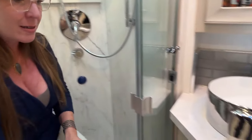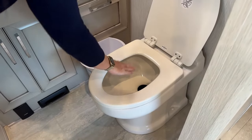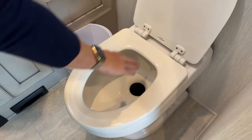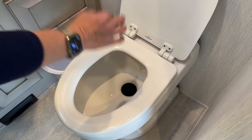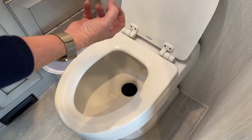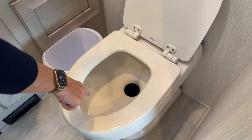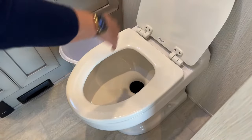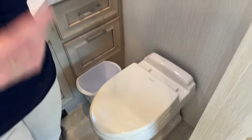Before you use your toilet, fill the water level up a bit first and flush it a few times, then put your treatment in there. If you're using a pod, you have to let it dissolve completely before you flush it — the plastic the pods come in will ruin the macerator in this toilet. This is not a FlowJet or SaniCon system — we can install that for you, but there is still a macerator at the inception into the tank. Make sure you're putting water into your tank before you start using the toilet.